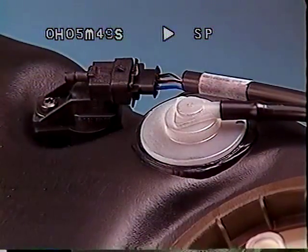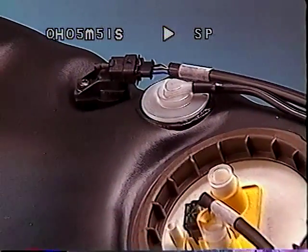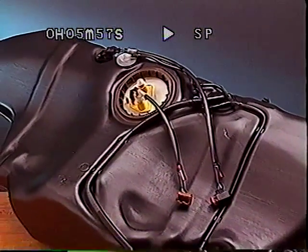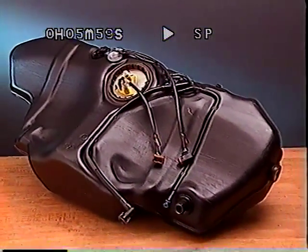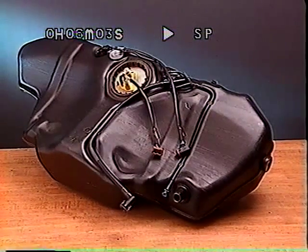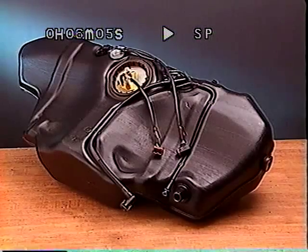Before examining the new OR-VR components, note that the plastic weld fuel tank and all its related components — except the pressure sensor and fuel pump — are not serviceable individually. This also includes the plastic lines. If replacement is necessary, an entire new tank assembly is required.